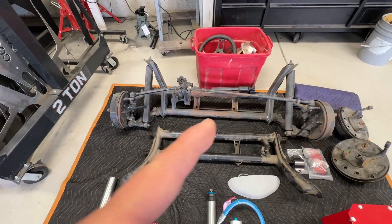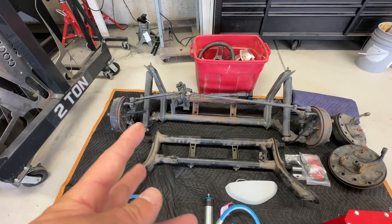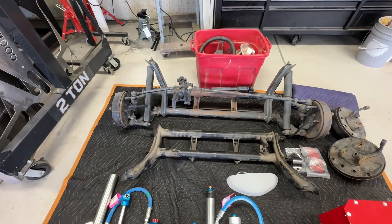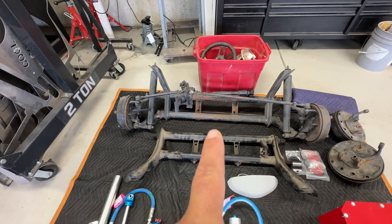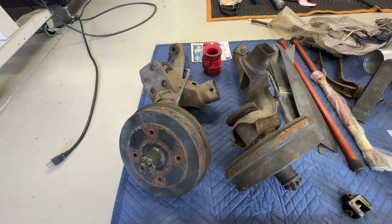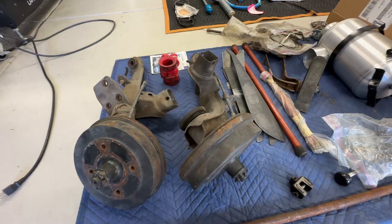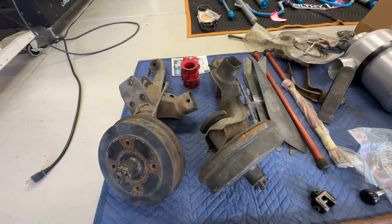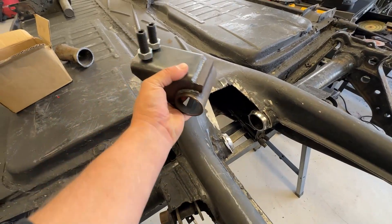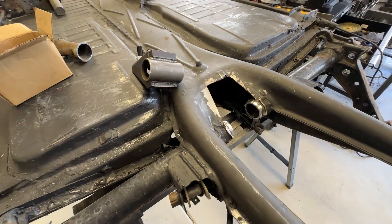Here's another look at the beam — I have two of them here. We'll be doing two beams at the same time in the video series, and we'll talk a lot about how the beams work. This is what you're going to need to look for when buying a VW Bug. These are the trailing arms you need. I already have a video that shows how to truss these with these plates, and a link for those will be in the description. Another video we already have is how to install the torsion housing adjuster.